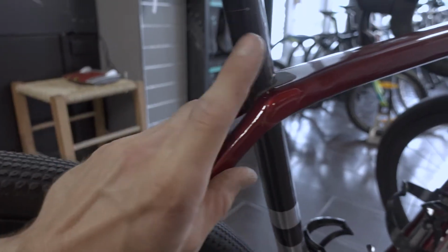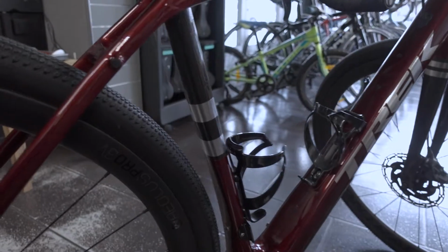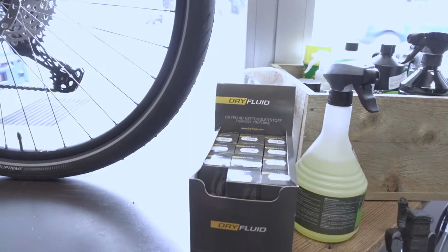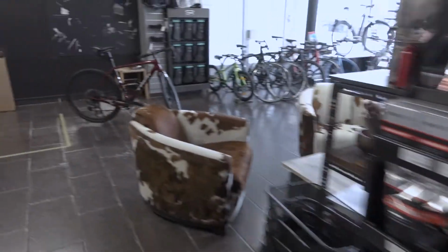Also, ISO-speed, I didn't tell you about this. You have the rear ISO-speed decoupler, which is pretty nice. It adds a bit more comfort, but of course, tires will provide your comfort on this bike. There's no argument for that, because you can go so wide, and this bad boy you can run at only 2 bars. How much is 2 bars? 2 bars is about 25 psi, no, 30 psi maybe. You can even go lower, I believe, when you set it up tubeless.